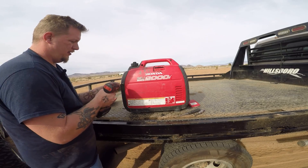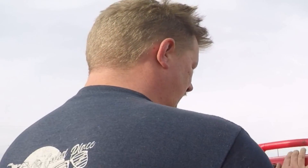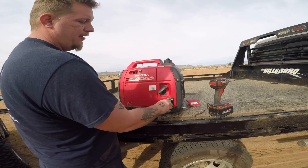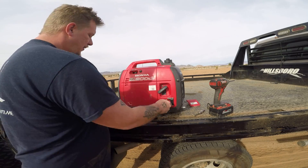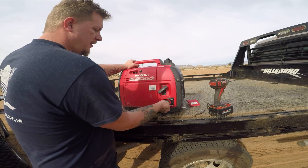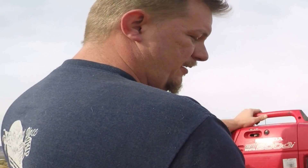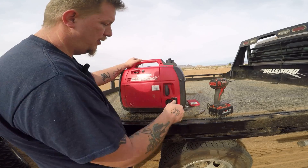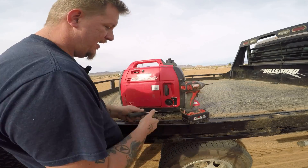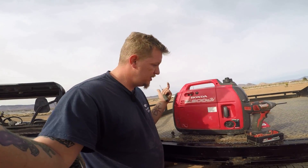Now we'll make sure it works before we get out of here. The way I was testing this originally was going on then off — when you go to off, if you hurry up and turn it back on the engine should re-catch and stay running. But with the old stop switch it would just die because it would get stuck. So now we're hoping it should just keep staying on. Running pretty good — off, on, off, on — it's working great now. If this video helped you guys, all you need is a 10 millimeter and a Phillips. I appreciate it if you would subscribe and stay tuned for more videos.